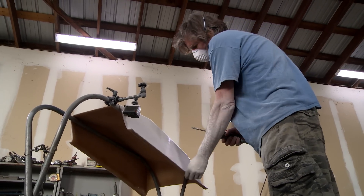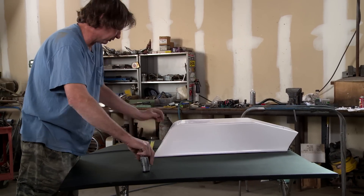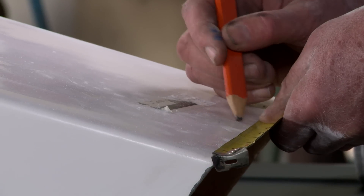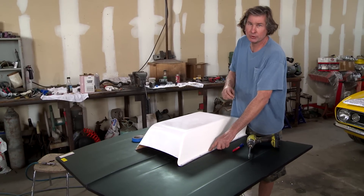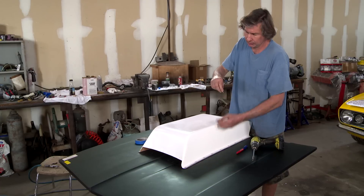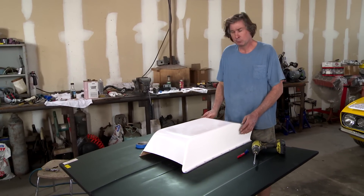What I like to do is come in here next and bevel that all the way across. Don't worry about chewing this up along the flange a little bit because this is all going to get glassed in after we bond it. So the first thing I'm going to do is find the center line of the scoop — I'm going to mark it on the front and the back because these flanges are not exactly equal and there can be some variation in the shape of the scoop, but the center line has to meet the center line of the hood. I've got the scoop in position, screwed down to the hood with these tech screws. The trick is you want to close the gap as tight as you can between the hood and the scoop. The way you do that is you drill it through normal for the screw size, but then you come back on the scoop side and enlarge the hole on that side only. That way the threads of the screw are not going to grab the scoop, preventing it from pulling down to the hood. That's really important because when we bond this, these screws are going to be our clamp.